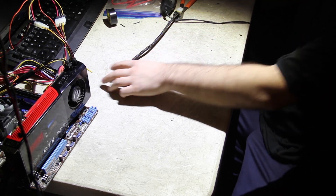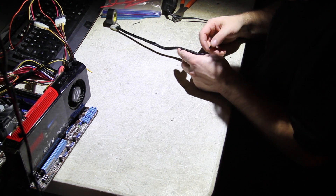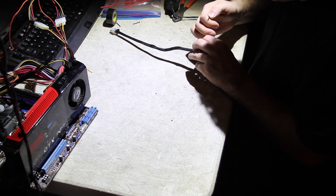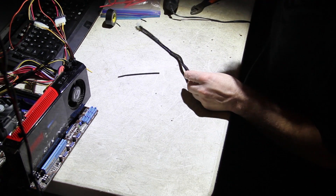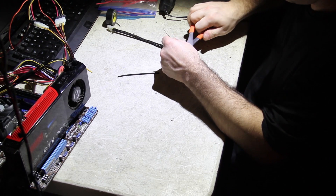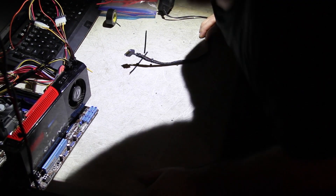We have this finished. The only thing you've got to do is use this — it's going to have two effects: it's going to hold that cable cover on from moving around, and it'll also add strength to my attachment points and my twists. I will actually do one more right here. We're good to go — one completed SATA to PCI Express 6-pin. I will actually pop that on the video card here in just a second on camera.